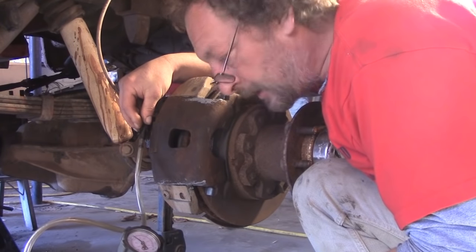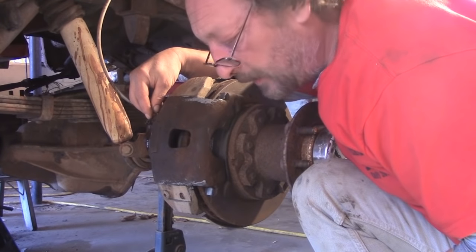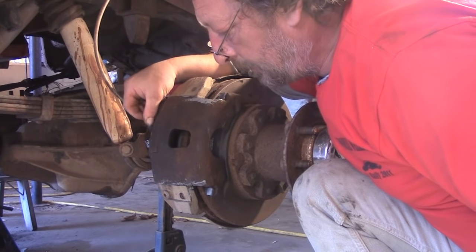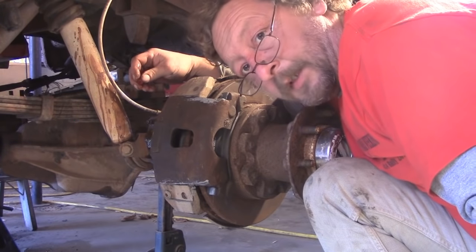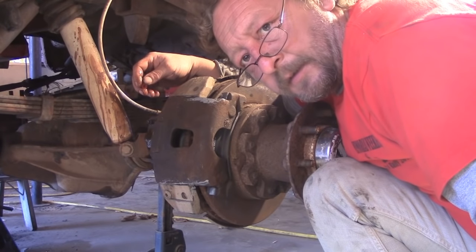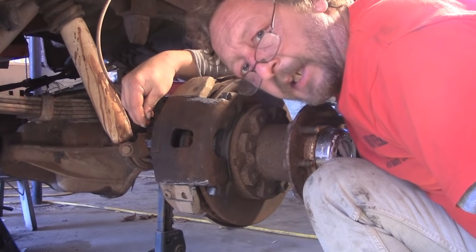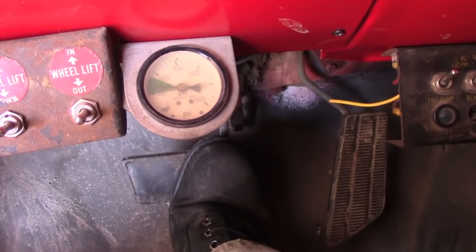One little tip I've learned about vacuum bleeding the brakes: when you pull the vacuum away, sometimes you can get a little air that sucks back into the bleeder. So it's a good idea to let it gravity drip a little bit before you close the bleeder. One last tip: if you're running out in the mud and the crap like I do, or even if you're in the northern states where you get snow and stuff, save yourself a little headache later on and put the caps back on the bleeders - it really makes a difference. Thanks for watching BSF Recovery Team. Keep wheeling, and maybe we'll see you out there in the woods. Hey, look at that - we got brake pressure again!